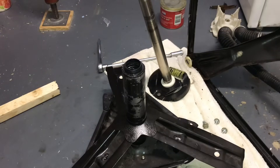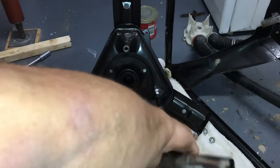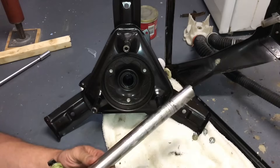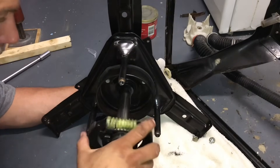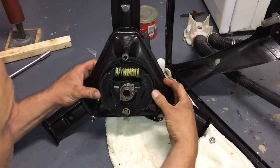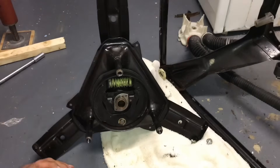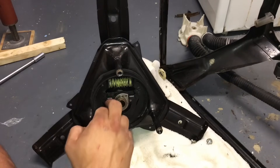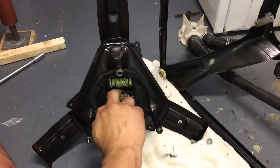Let's start putting this thing together. I'm going to put some of this lubrication on the shaft, just kind of rotate it like that, and compress these brake shoes so that it slips in. I'm going to take just a little bit of high-temp grease and put a little bit on this cam just to re-lubricate this piece right here.